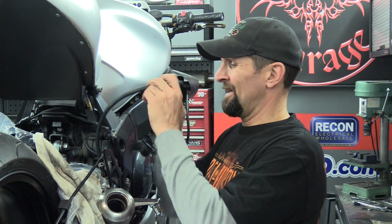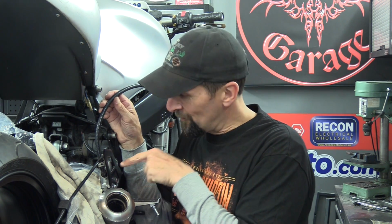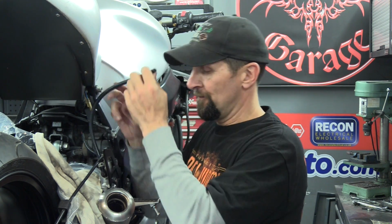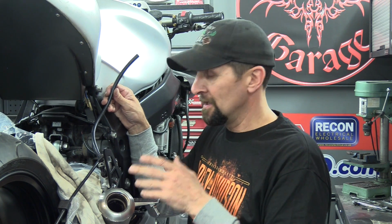Now, it might seem perhaps logical to assume that that's too small a bore to supply the fluid to that hose, but then the internal bore of that plastic union is 6mm, which is the same internal bore as this. So although that's quite a stretch to get that over there, and this is a way thinner hose than original, the internal bore is the same as that plastic internal bore. So it's going to supply plenty of fluid, and it's not supplying fluid anyway unless you're bleeding it. So that I'm happy to call safe.